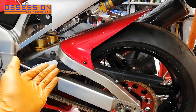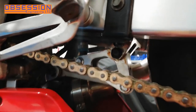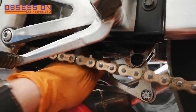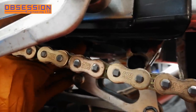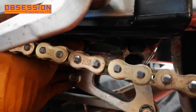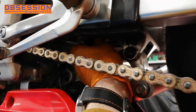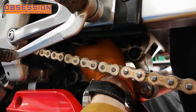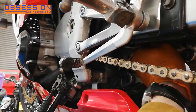The next thing to do is have a look at the rebound adjuster. Because this is an old style shock the rebound adjuster actually affects the compression damping as well. It's a little plastic adjuster on the bottom of the shock. So again what I'm going to do is wind it all the way in — we're bottoming it and the first click out will be zero. We're at about 50 clicks of adjustment but we're not going to need all of those.